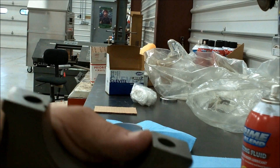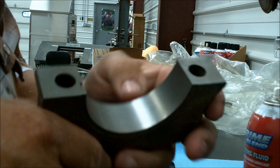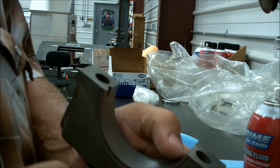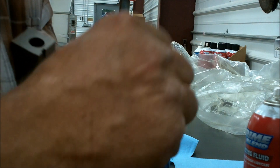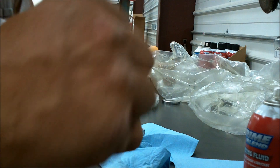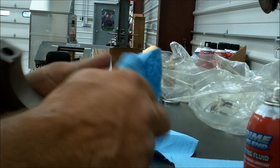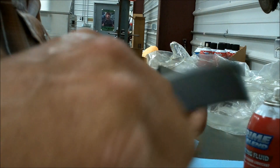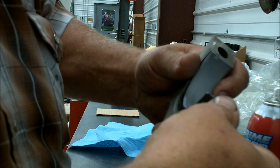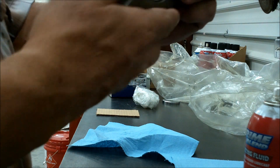These caps have been line honed so they're really super sharp right here and they will cut the bearing backing off every time you try to put it in. So I just take a little sandpaper and take a little bit of the edge off there so it's not so harsh. Now you got to put this bearing in, get it up here in the tang, and just kind of push on it a little forward and it goes right in.